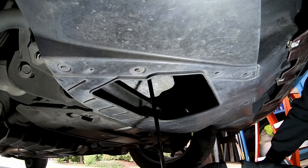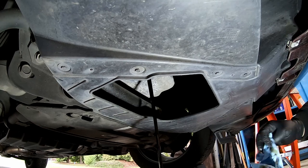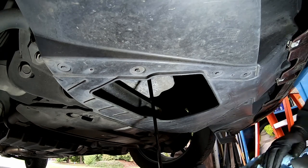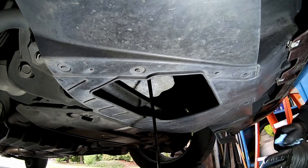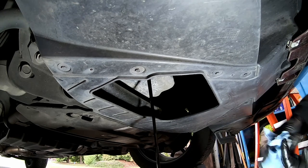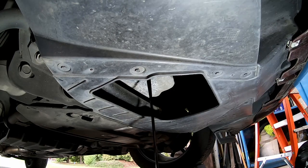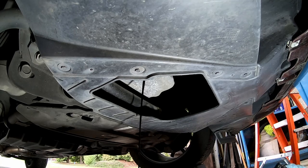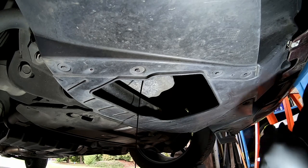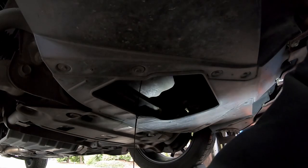Only a little bit of splashing. I prefer to do this hot when I can. Worst case scenario I've done oil changes cold — stone cold, not started at all. The last thing you want to do is start an engine for like a minute to do a reposition in your driveway and then turn it right back off, because then you get a bunch of cold oil sitting up in the top of the engine that you'll be waiting an eternity to drain out.